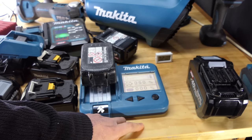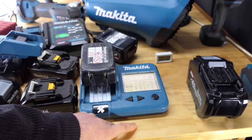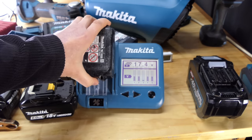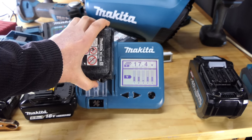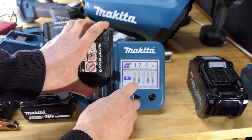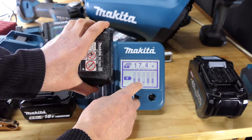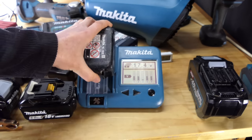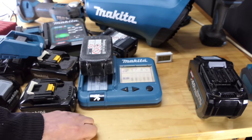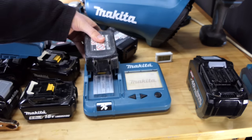Battery health. That's the killer here. Nothing there. And that shot there. We're not getting over 17.4 volts, but the big thing, that number 3 slot. Remember, these are in parallel, so each one of these is actually 2 cells, so these ones are probably alright. This one, I'd say one of the batteries might be alright, and one of them's knackered. So, sorry Mitchell, your battery is stuffed, mate, but I guess you already knew that.